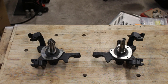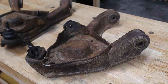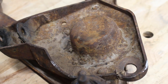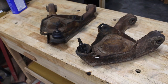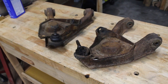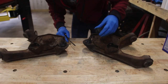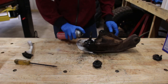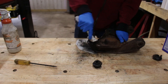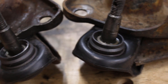These look good. However, I think the biggest offenders here for rust and just overall showing their age are the lower control arms. They are what you call crusty — there's just so much rust over every surface, not to mention their rotted out bushings and worn ball joints. The ball joints are a little different than the other two pairs in the car, because rather than being bolted in, they are a press fit. On early model Fieros they were tack welded in place after being pressed in as a little extra insurance, but these appear to not have that, so that makes it easier for me. Pressing them out honestly went very smoothly, besides the fact that I lost the footage of me doing so.